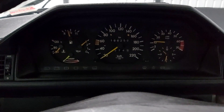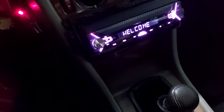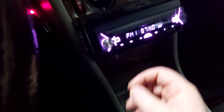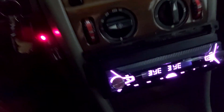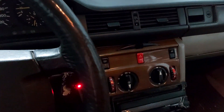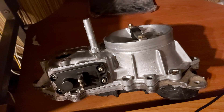Once you start the engine, a very important thing: turn off all electronic consumers. For example, the stereo is on — look — you need to turn that off. Also the ventilation, and as you see this button, when these lights come on, turn it off. If you have AC or anything else, the lights — turn them all off.